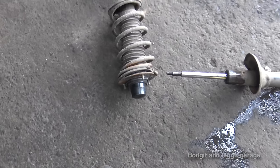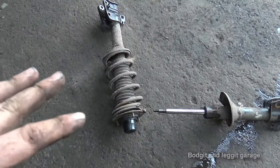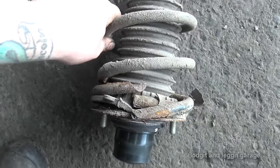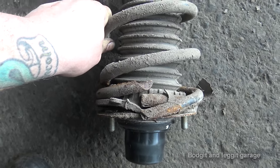I remember saying to the customer, I'm surprised because this spring is broken. I don't see the Jeep kind of at an angle. The Jeep kind of looked level. And the reason is because the other side has broke as well. Not as bad as the first side, but it's still broke. So that's why they look kind of even.